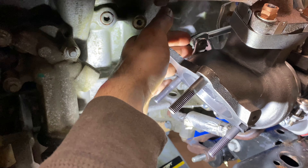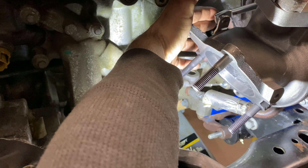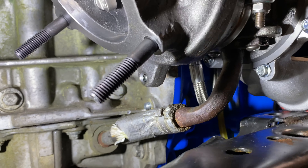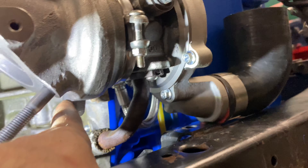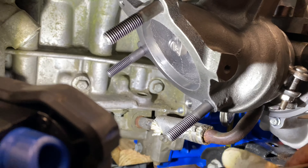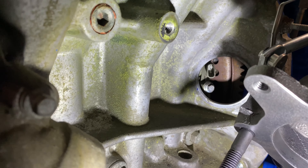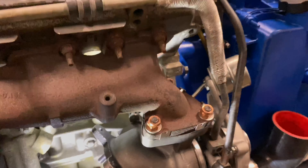One thing I do want to touch on is we have a plug back here that's very, very challenging to get to. There was a heat shield in the way, but that heat shield does not fit with the bracket due to the fact that we have that stainless coolant line coming out of the bottom of the turbo. I think that bolt hole was actually still for that elbow bracket, and I can probably sneak in the elbow bracket and the heat shield. What I'd advise you guys to do, if you're in a situation where you unplugged that, is wait until that harness is reconnected and then mount that stuff back up.